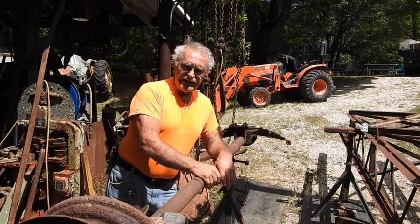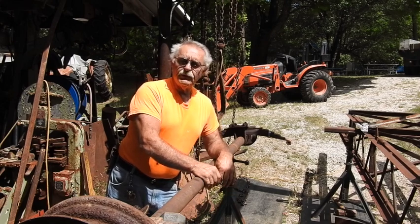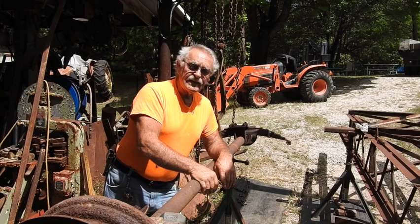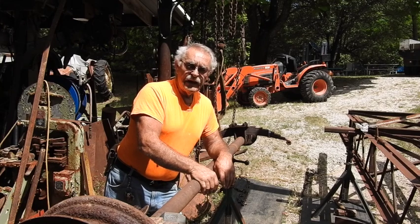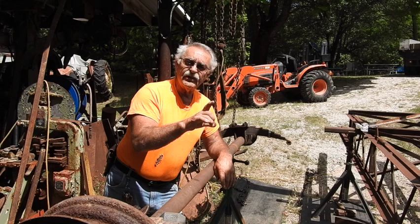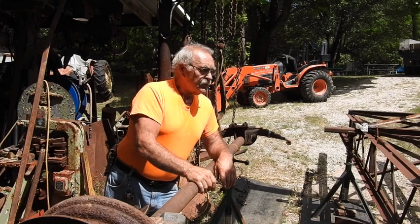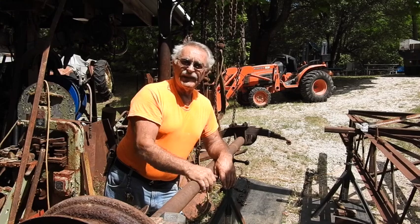I've got this one here I picked up over at my much older brother's house. It's an old 50s mobile home axle. I'm probably going to eliminate some of the springs because it's got at least 4,000-pound springs under it. It's got a stack of seven leaves, and I'm going to take off every other leaf to shorten the stack by probably an inch and a quarter, inch and a half. I had to buy some new shackles and everything, so that's what we're going to do — get this thing straightened up and ready to go.